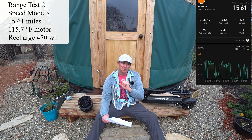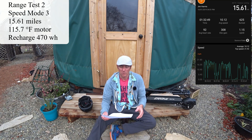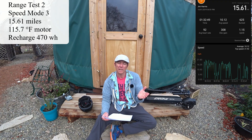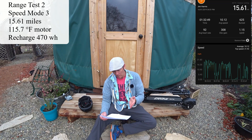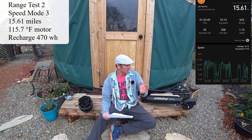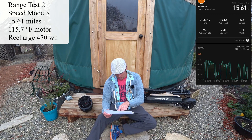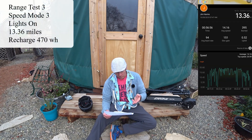A lot of people have heard you can get a little bit closer if you fine-tune the tire size setting, but I haven't really played with that. During this test, the motor temperature was 115 degrees — a little less, but it was cooler outside, around 70 to 75 degrees. I also rode this in multiple trips, and in my last trip I was only going a little over three miles, which probably contributed to the lower motor temperature. It took 470 watt hours to recharge.